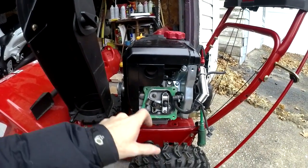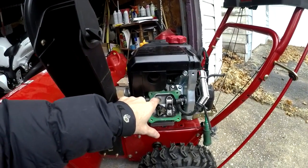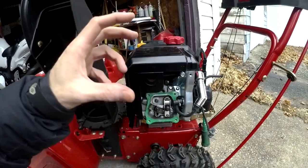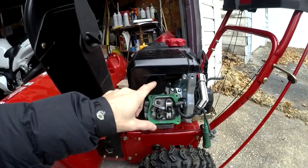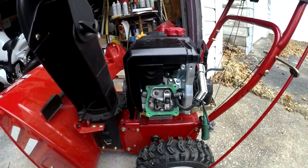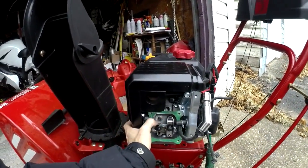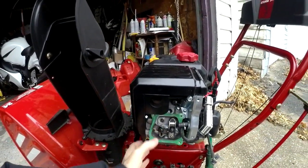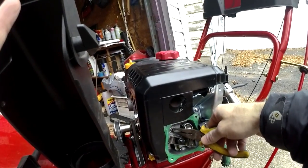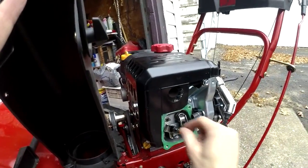Now we're at the valves. I pulled off the valve cover to check the clearances and what I came to realize is this valve — the exhaust side valve — seemed like it was stuck down or open. That would make sense: if it was stuck open, pulling the starter would cause a backfire and wouldn't give it suction, because every time it tried to suck in it would pull outside air. I sprayed some WD-40 down on the side of the valve, pulled it out, tried to loosen it, and now I can push it in with my thumb.